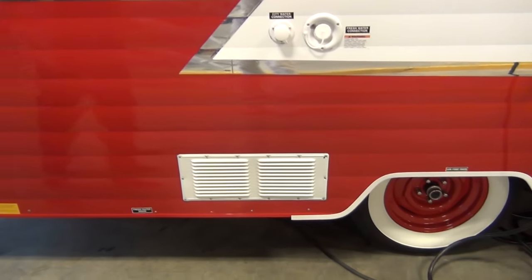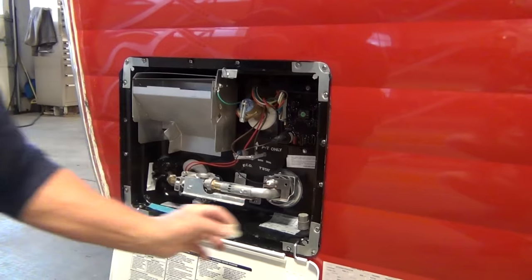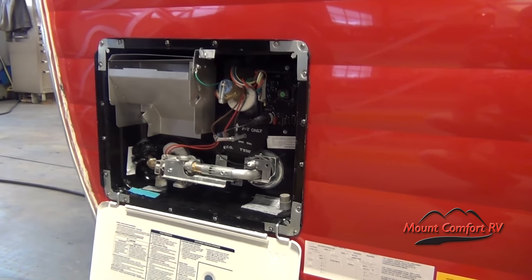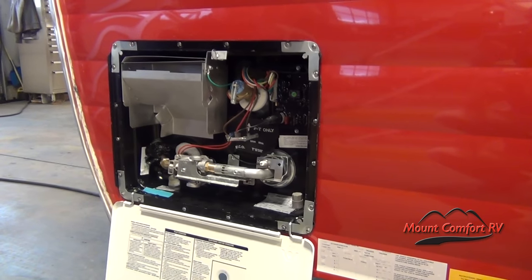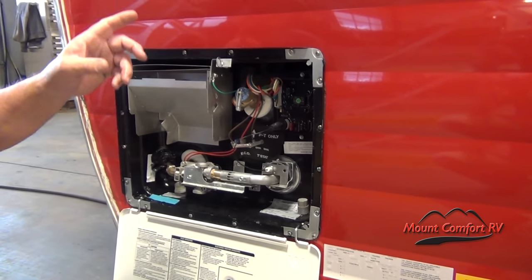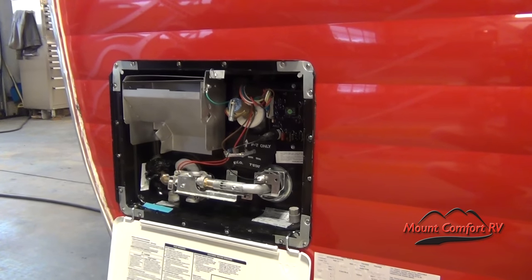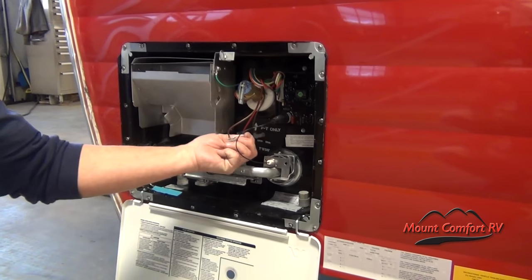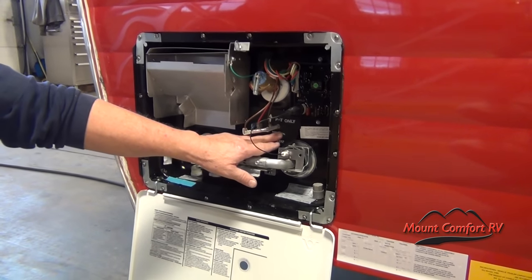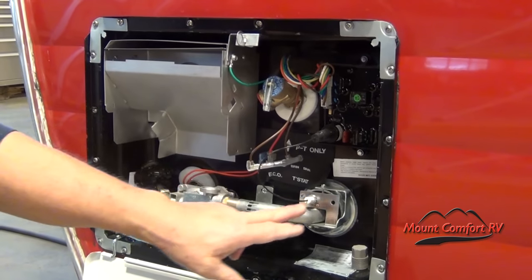This is the vent for the back of the air conditioner. This is your hot water heater. The drain plug goes in here so we don't lose water — make sure that's in. You fill it either using city water or the pump. Once it fills, there's a bypass valve on the backside for winterization which we'll show you later. This particular unit works off electricity and LP gas, and you have a switch on the inside to choose which one you want. This is a heat sensor — we want this left out here. If the tube gets blocked and flame comes up, this will sense the flame and shut the water heater off. You have a preset thermostat — one set at 140 degrees and a backup at 180 degrees. And there's your pop-off valve, igniter board, igniter, burner tube, and gas valve.